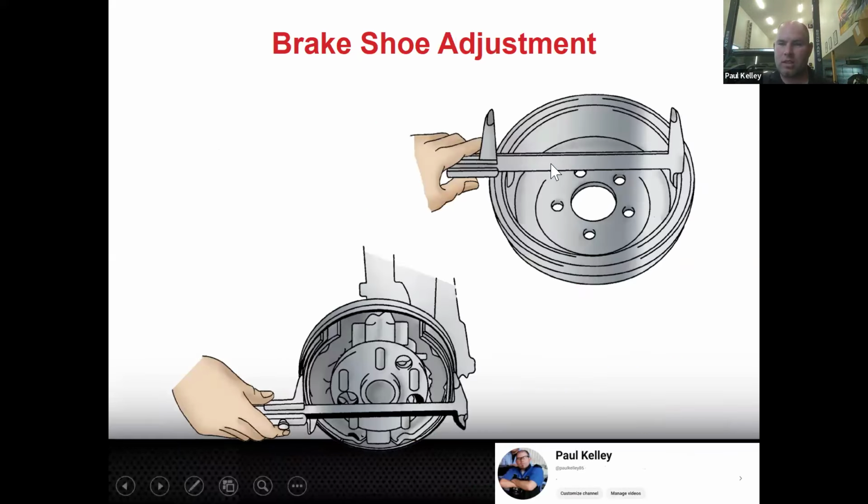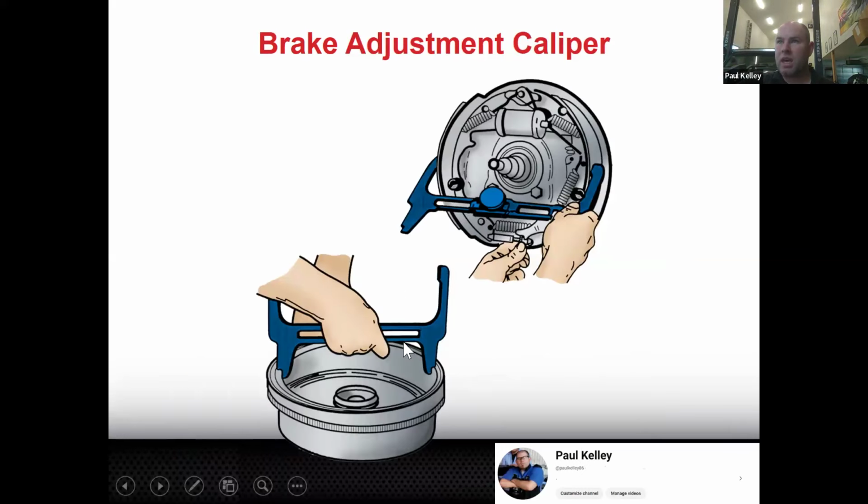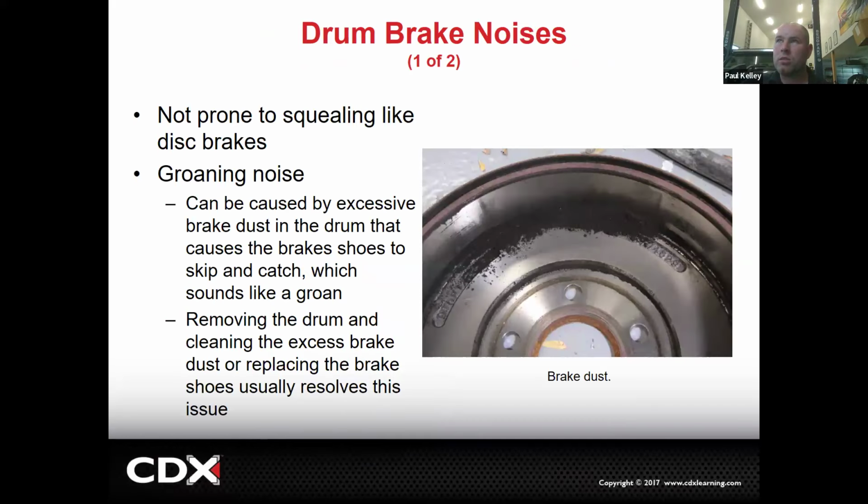This, however, is not a precision measuring tool. This is the tool to pre-adjust the brakes, like we had talked about. So we would actually expand the tool to fit the drum, lock the lock nut, swing it over here, and adjust the adjuster so the brake shoe contacts the tool, which was set to the drum. And that's a pretty good tool. It's all right. But for some people who tried it, sometimes it's hard to get it exactly fine-tuned, so there's other ways to do it. And I got a pretty good video on the way that I would adjust the drum. In fact, I got about 3 different ways to adjust drums.